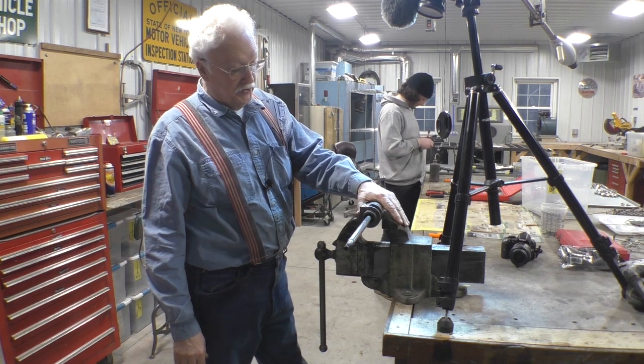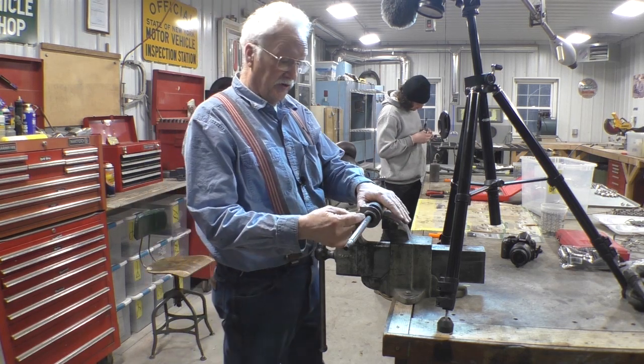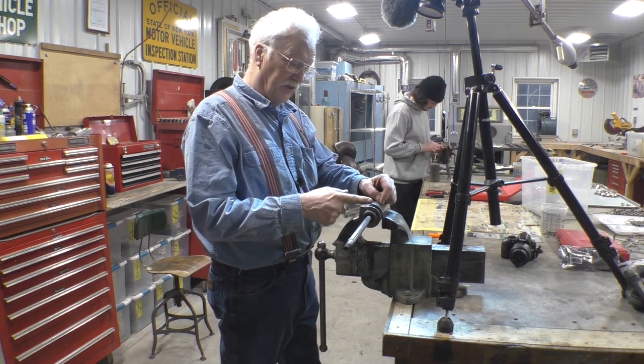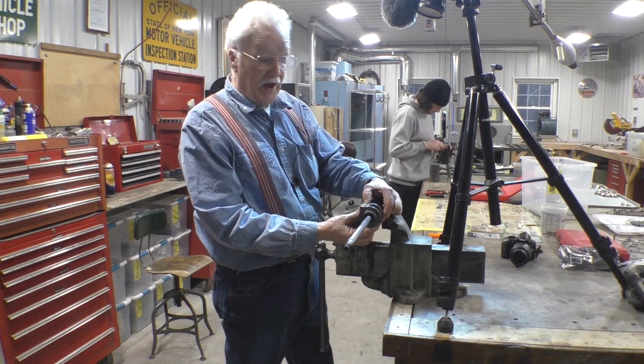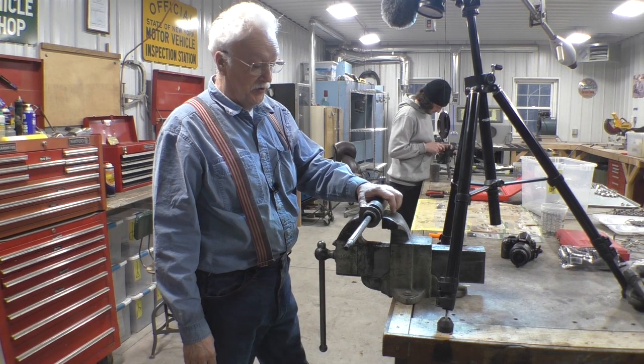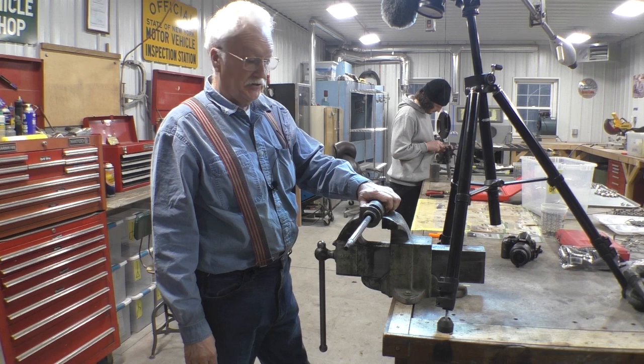And there's not much we can do in a rebuild here other than put seals in the front. In order to do more work, you actually have to cut the top off and re-weld it back. So people seem to prefer the Monroe and they say it's simpler.